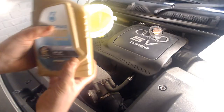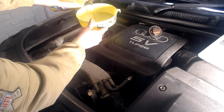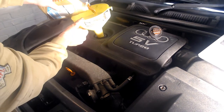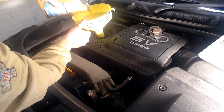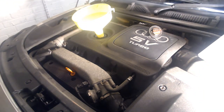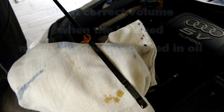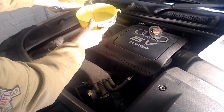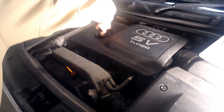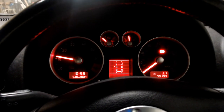Two 1 litre cans for £10. The car will hold 4.5 litres of oil when full according to the manual, so filling should cost £25 with a little oil left over. These 1 litre cans are much easier to pour than the cumbersome 5 litre types. So I add 4 litres of the oil to begin, checking the garage floor for any sign of leaks — all good so far. I then leave for 5 further minutes to allow all the oil to settle in the sump. After 5 minutes, pull the dipstick out and give it a wipe on a cloth. Check the fill level on the hatched marker at the base but it will still need to prime the filter. Carefully add another 200ml of oil, replace the filler cap and start the engine. The oil pressure light may come on initially while the engine comes up to pressure but it should go out shortly afterwards. Do not raise the revs of the engine above idle during this time to prevent engine damage.